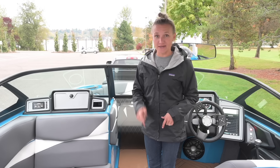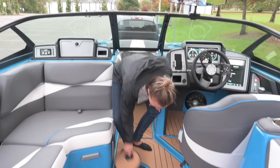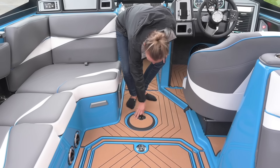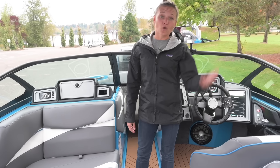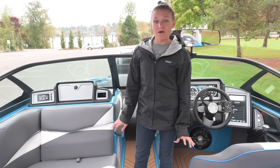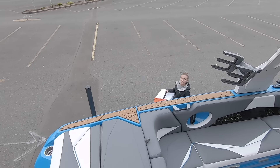This one has a transom plug and a T-plug, so I'm going to check both. I already checked the transom plug — now I'm just making sure the T-plug is in. That's only going to be out if you or your service department took it out, but it's not a bad idea to check every time. The boat is ready to go now.